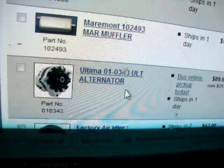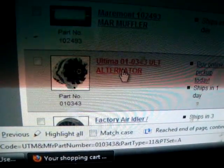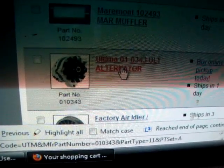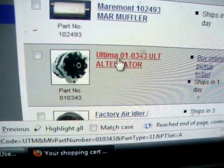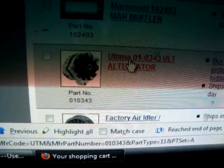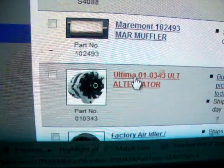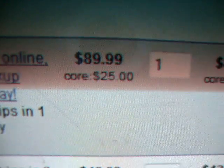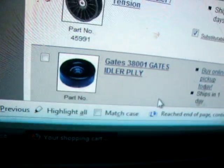Alternator — the bearings on my alternator are going out. In my video where I showed you guys tips on changing belts, you could tell it squeaked. It was intermittently seizing up sometimes, making the belt burn and squeak. I think the bearings on the alternator are actually seizing up occasionally, so I need to replace it soon. A new one is $89.99 with a $25 core. I'm probably just going to get a used one for like $40 — it'll probably outlast the truck.